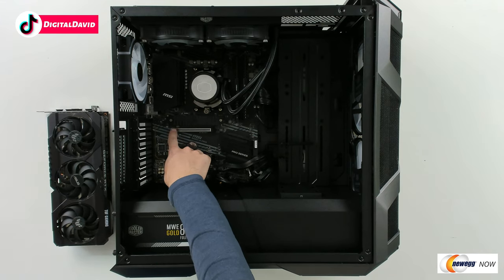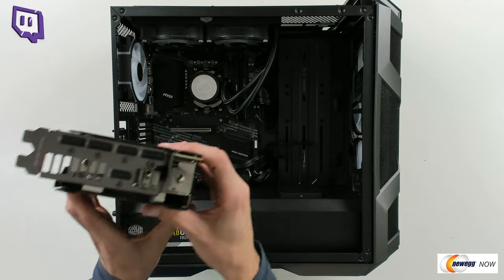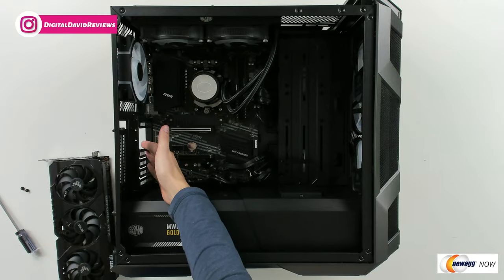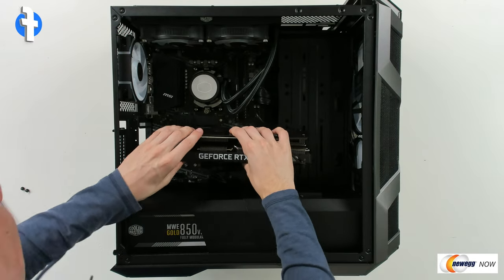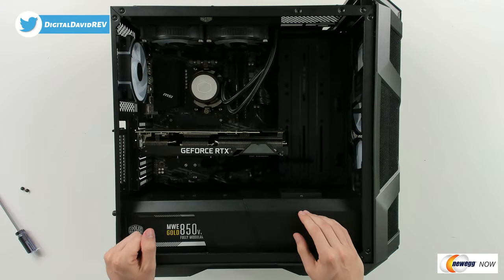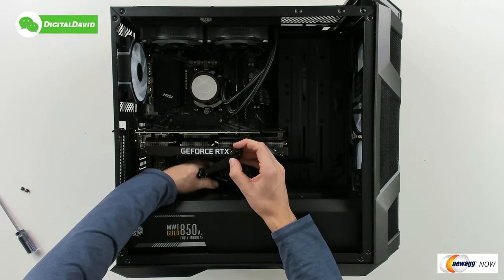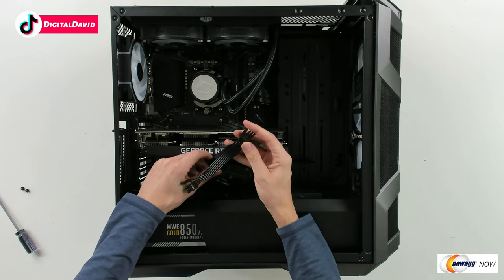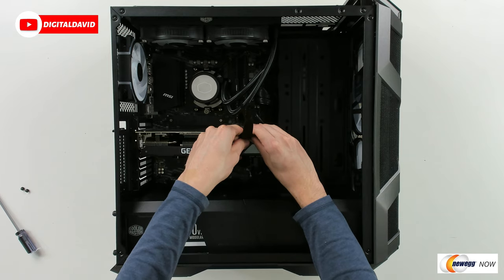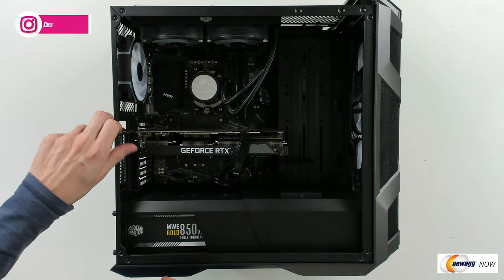Now it's time to install our GPU. We're going to install it in this first slot right here, so we have to prep our case and remove these two covers to make sure it's going to fit with the back plate that we have for our GPU. So we need a Phillips head screwdriver to remove these two covers. Now you can see the two covers have been removed, so we can take our GPU, line it up like so, and just gently snap it in place — you can see it just fits. Here we go, we have our PCIe power cable right here that we can pull out some extra. We're going to need a little bit extra, then we can bring it around, gently line everything up, snap it in place. Now we just need to fasten the two screws back in place and we have successfully installed our GPU.